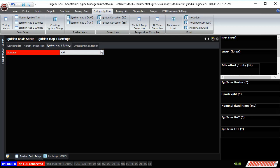If you don't have a MAP measurement at all then you'll need to use throttle position instead. This doesn't correlate all that well with pressure in the cylinder, because at low throttle openings at low RPM you may actually be up to the full load of the engine already because the airspeed through the throttle is so slow. So actually tuning a TPS ignition map will take longer than tuning a MAP-based ignition map.